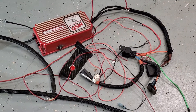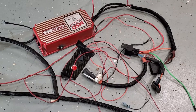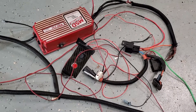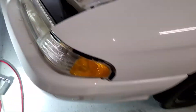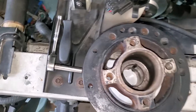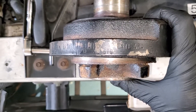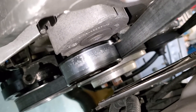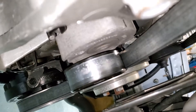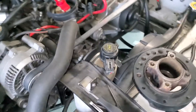I moved on to putting the distributor at 50 degrees before top dead center — that's one of the requirements for the dual sync. It wants you to install it at 50 degrees BTDC. Luckily the balancer I have has that mark, whereas the stock one only goes to 30. I replaced it with a Pioneer SFI-approved one — you can see it kind of shifted and spun like a lot of them do. It goes to 40 and it is marked above 40, so I can get to 50 degrees and get ready for the dual sync install.